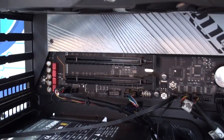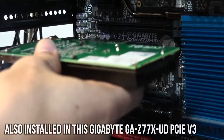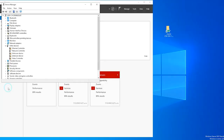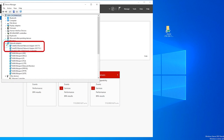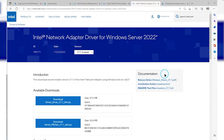For example, this motherboard we're using features a version 5 PCI Express slot. We installed this network card and, as expected, we did not have to install any drivers — at least in Windows Server 2022, which is the one we use the most for our enterprise scenarios. This hands-free driver installation is due to the fact that internet connection was available and drivers were automatically downloaded. You may find some cases where you need to wait until reboot for the card to be recognized.